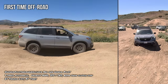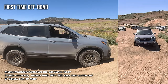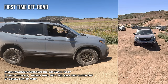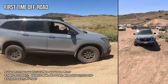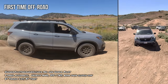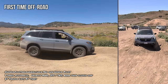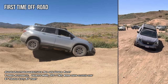All right, here's another thing too, is traction control in this Honda, it really only works up to about 1800 RPM. When your RPMs are faster than that, it actually kind of disconnects. So that's why David was able to slowly crawl up it, okay? You'll start hearing the crunching. You hear the crunching? That's the traction control system doing its thing.